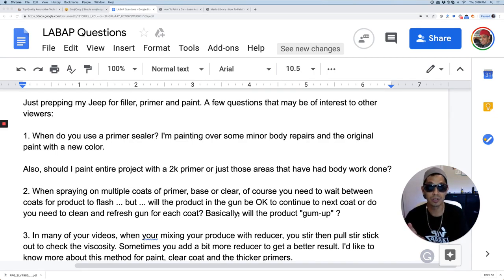There are sealers where, if you use a 2K primer sealer — which is like a primer filler sealer — it's recommended to sand it down before paint. Some sealers flow on nice, but I really like to do primer sealer and then sand it down with 400 to 600 grit wet. Make it really nice, and then do my base coat and clear coat over that.